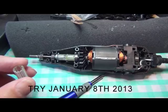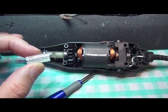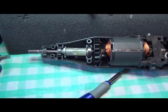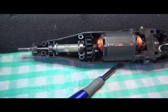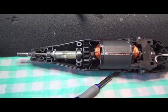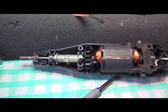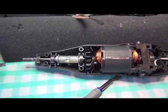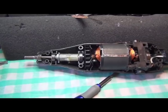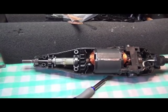I've gotten a lot of use out of this tool but I just hate to see a good machine go to waste because of a $1.48 part. I hope this helps you if you've been trying to figure out how to get it back in operation. You don't need the heat shrink, and if your gear is not chewed up you don't need the epoxy. I used epoxy because I was down to less than half the teeth on the spline, which makes it wear out twice as fast. The teeth get worn down on the inside somehow. I'll put this back together, turn it on, see if it whizzes and works, and that'll be about it.